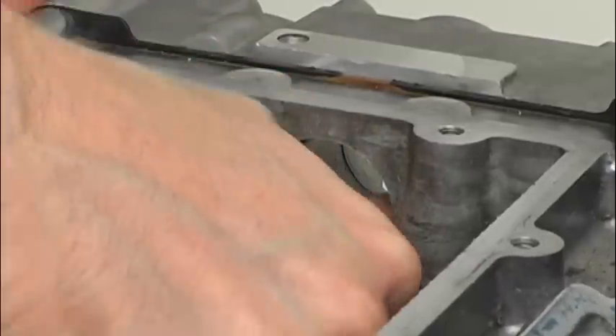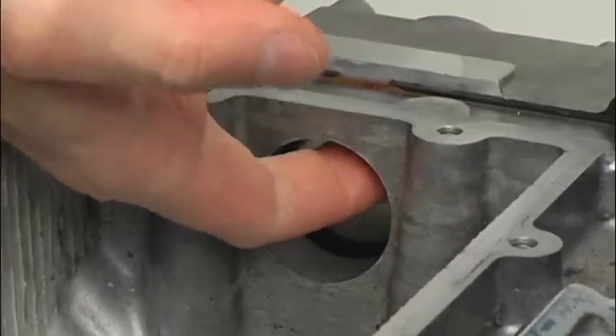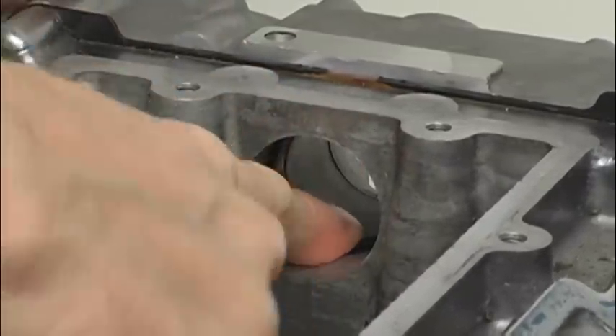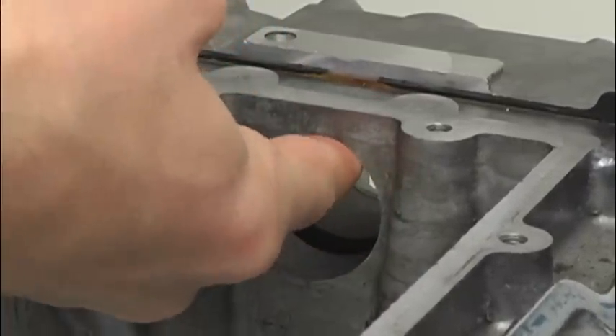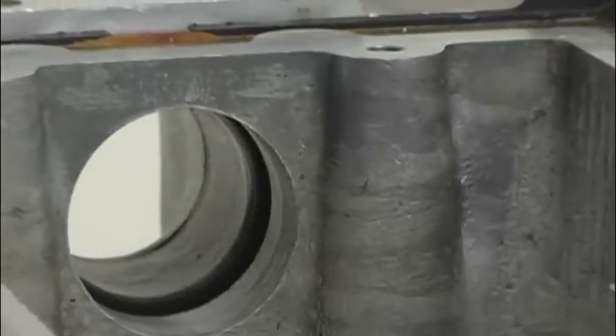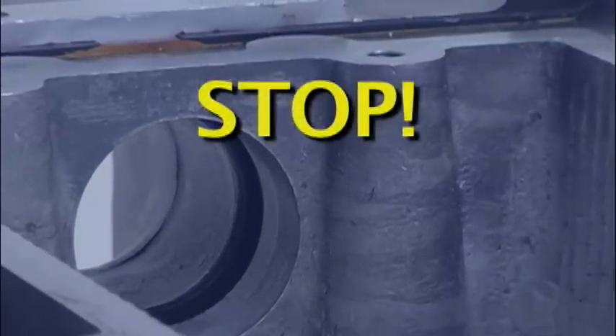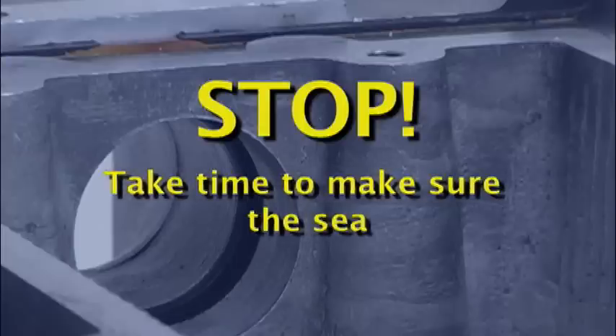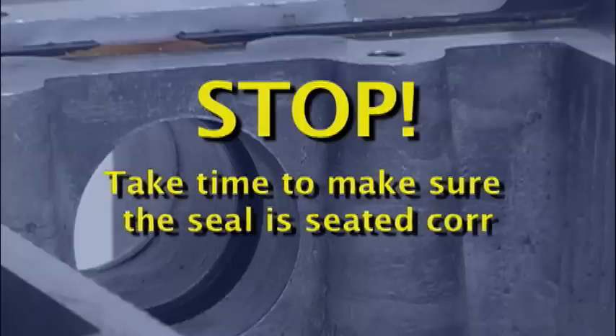Great attention needs to be paid to make sure the new front seal is fully seated in its groove. This is evidenced when the inner edge of the seal facing the intake gallery is flush-fitting with the tube opening. Very firm pressure with your thumb or a smooth, blunt instrument may be required to get the seal fully seated. It may take several passes applying pressure before the seal seats.